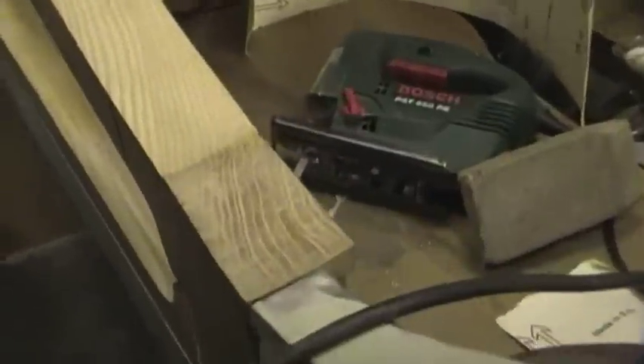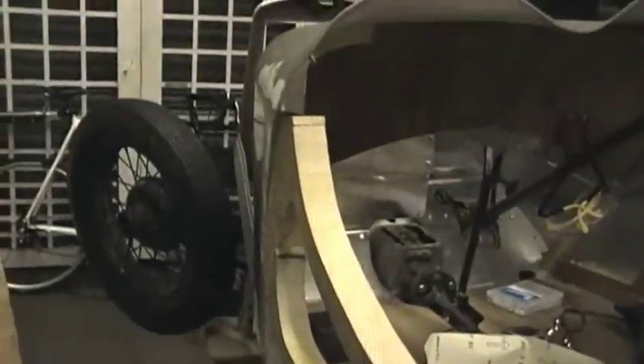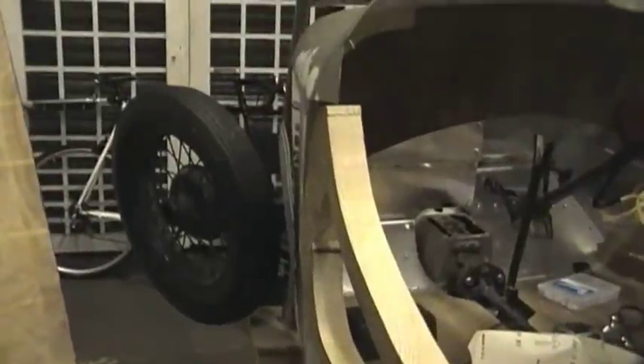I've mounted this rough door and you can see it's about 12–15mm oversize on the width. As you follow it around you can see it's fine at the bottom, but as we come up to the top the twist on the door is different from the twist on the body. So what I'm going to have to do is loosen the fixings and just twist the door into shape — the extra thickness on the timber gives me enough extra material to carve the pieces into the correct shape to match the body. The raw door frame pieces are actually slightly twisted to allow the door to match the sloping shape of the body.